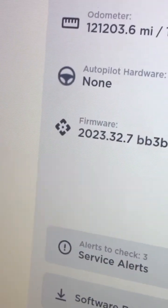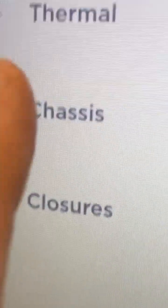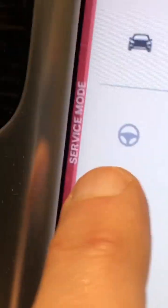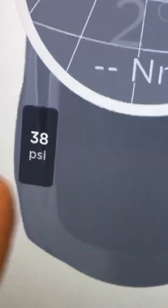All right, so there we go — there's the service menu. Now there's all sorts of things in here that can show various alerts that you don't need to worry about, but you're going to go to chassis. Chassis is the one we want, and when we hit that there is a tires and alignment option. I have the original system and there are my individual PSI numbers — I got a 38, a 39, and a 40. Oh my gosh, the cold weather...